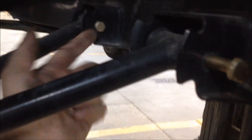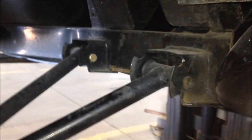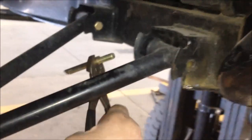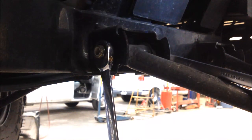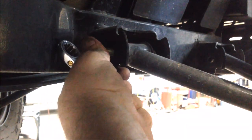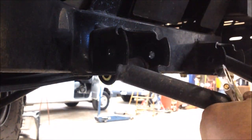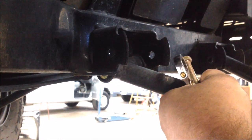They did it on this one — I guess it's just automated stuff at the factory, but that was just an engineering flaw. Go ahead and push the bolt that way and just grab it with a pair of pliers. Let's go ahead and take the other side off, push that bolt through, and then your A-arm will swing free.